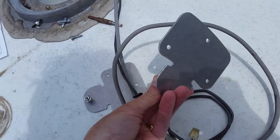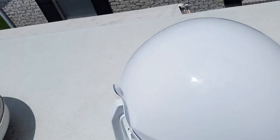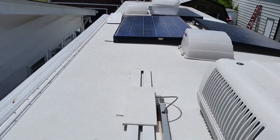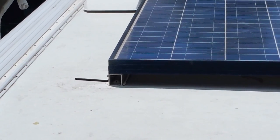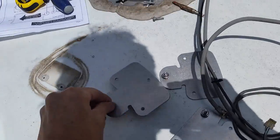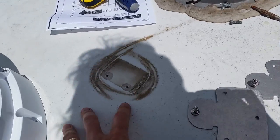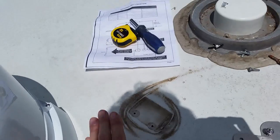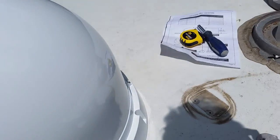I got these cool feet that mount to the fiberglass roof. I got this really good stuff - I've actually used it back here years ago when I put in my solar system. You see those aluminum pieces that are bonded to the fiberglass - really strong adhesive. So that's what I'm going to use to adhere these feet to the fiberglass. I'll put a couple screws in it, but this fiberglass is really thin - it's mostly just styrofoam, five or six inches of styrofoam in the center. So you don't want to rely on just that fiberglass to hold something like this on the roof.